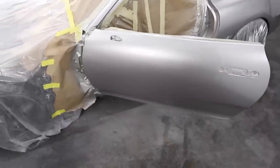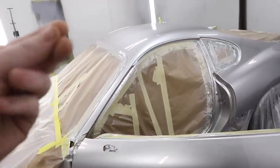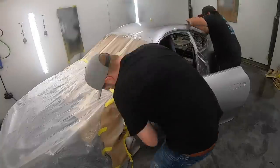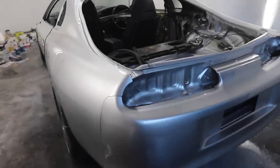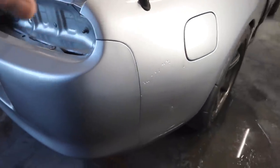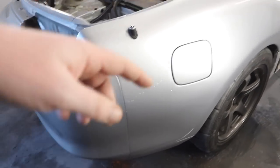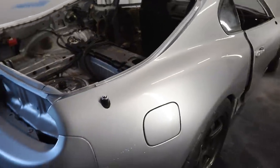We have a painted Supra! We've given it a little bit of time to off-gas. We forgot to pull the masking off in time — you should pull masking off when the paint is tacky so you don't accidentally pull the paint back with the masking, but mistakes get made. We are unmasked — it didn't cause any issues. I did make one massive mistake, which is an epic-size run basically from here, a little bit through here, and then all through here. Runs suck, but they can be sanded out of the clear. Not having enough clear buildup — that's a real problem because you can't just add more. I went heavy with a brand-new gun and pretty much new system, so we got some runs throughout this quarter panel. We'll be sanding those off in the next episode and showing you guys how to clean those up. But the rest of it is nice and glassy looking.